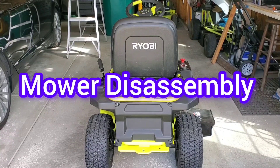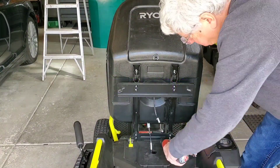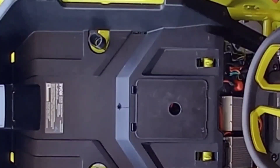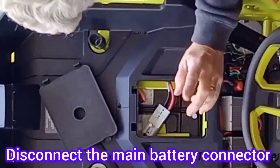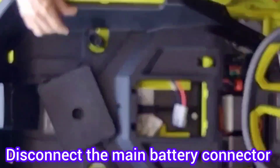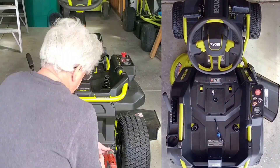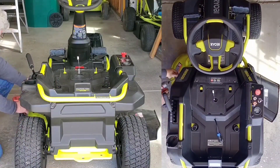You may also want some tape or tie straps, and a big piece of 2x4 for bending one of the brackets. The first step is to remove the seat — the bolts use a 14 millimeter wrench and a 13 millimeter socket. Then disconnect the seat switch, open the inspection cover, and disconnect the main battery.